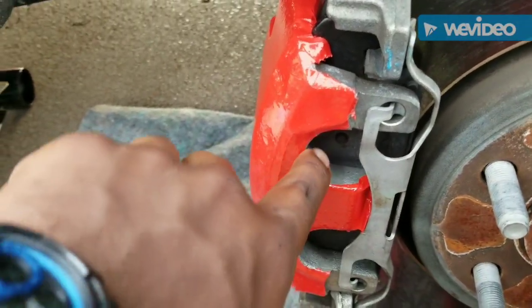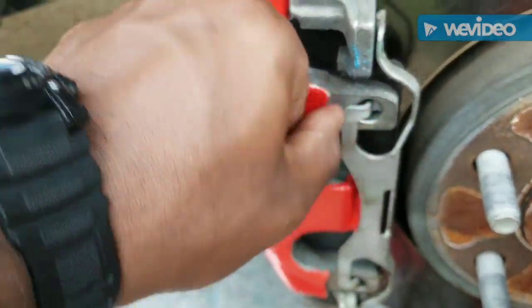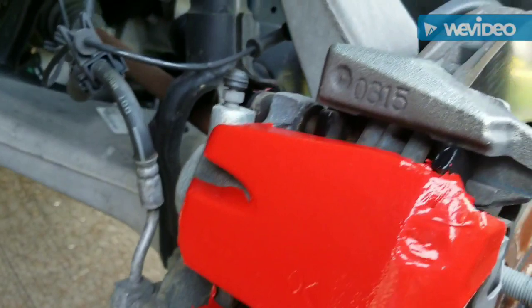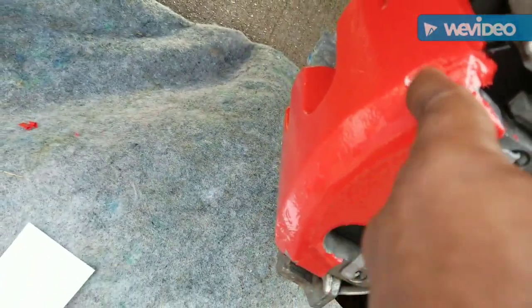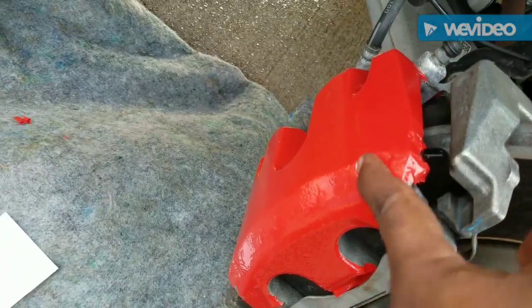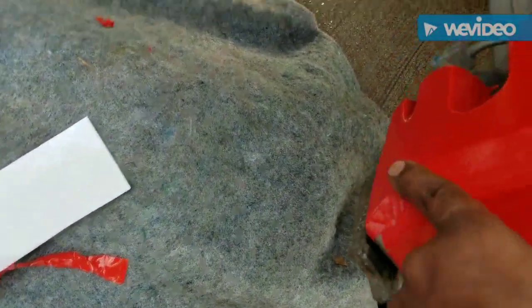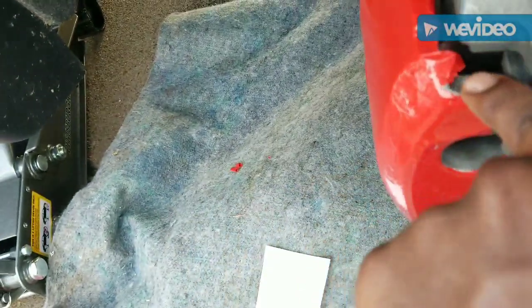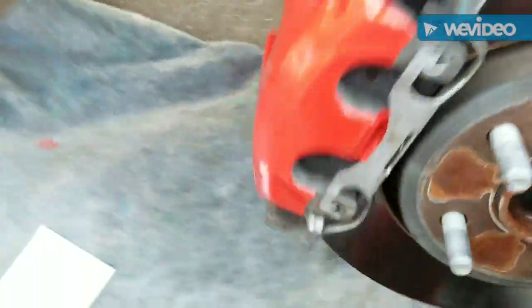So this is where I'm at with it so far. I cut out those little inserts and molded it across a hard line. Then all you do is come back and cut off any excess, or mold it down in here. I'm going to mold it in and cut around any excess. Same thing down here — I'm going to get a little piece and stick it right here, and you're not even going to be able to tell that part was missed. From the side it looks pretty clean. Little areas where it's like little pockets, you just want to punch a hole in it and mold it with another piece — punch a hole, cut it out, and you can put another little piece using the extras you cut off. You can fill the little holes in with a separate piece so the air can come out and it won't bubble up on you. For the most part, this whole piece is covered. You just got to clean it up a little bit — cut around any little pieces because you don't want any jagged lines. I'm going to come back, hit this top and bottom, and move to the backside.